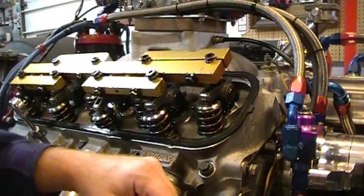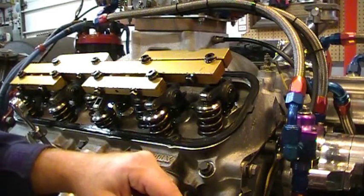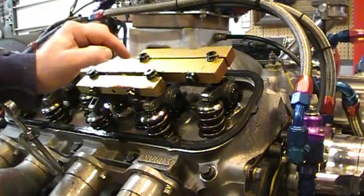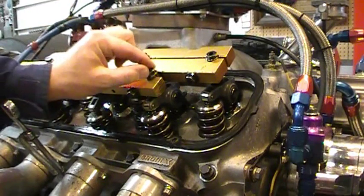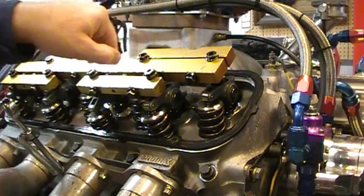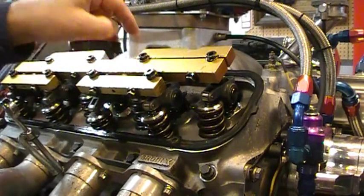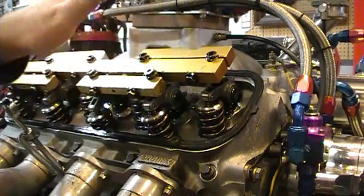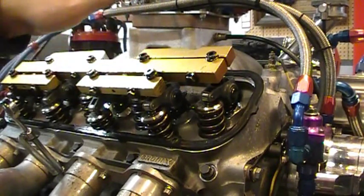The intake is going to need a little bit of adjusting. If it's off a little bit, not a big deal — it's when you notice something off a lot that you've got some kind of problem you need to look into. To adjust these, put a wrench on your adjusting nut. Counterclockwise will increase the lash; clockwise will decrease the lash. It screws the nut further down in, which tightens up your lash, or if you back it out, it loosens or increases your lash.